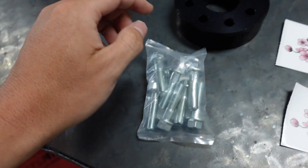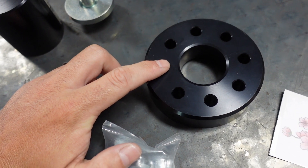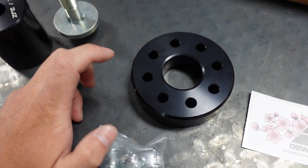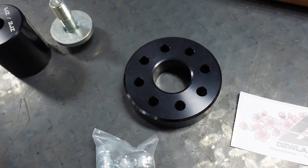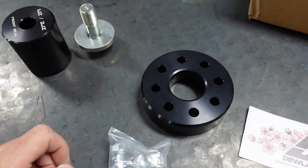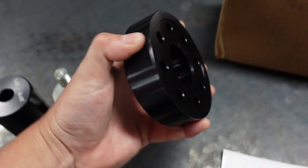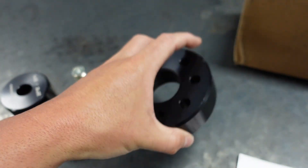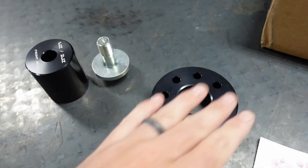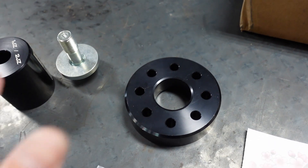Now I know what someone's going to say about the rear main seal — it has eight bolts on the backside. Those eight bolt holes are for the flywheel when you bolt it up. Someone's going to say: would you really need eight bolts to install the seal? No. But I heard his thought process — same thing with me — if he didn't put that, someone would have said you need eight bolts to evenly put the pressure on. You can get away with two. Two will do it. Look how big a piece of aluminum this is — two bolts, one on each side, and slowly crank it down until it pushes the seal in.